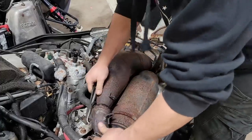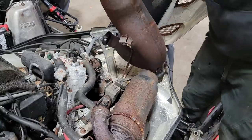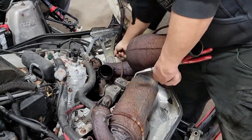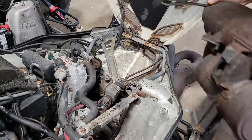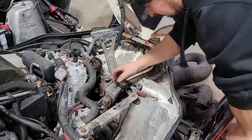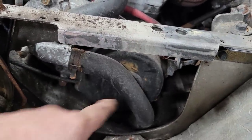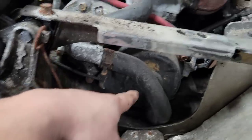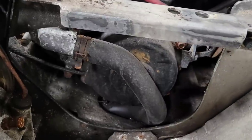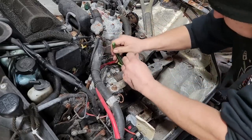The hardest part most of the time is just remembering where all these springs went. We got the exhaust off. There's a bit of a cooling pipe in the way, but there is the recoil. I've got some clamps I can pinch these hoses off, pull that one out of there, and then what looks like four bolts holding her on — and we should be tickety-boo. I don't know how much coolant will actually come out, but we'll put the pinch clamps on just in case.